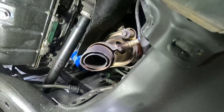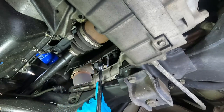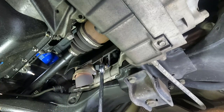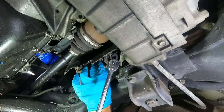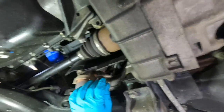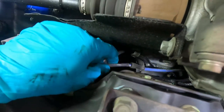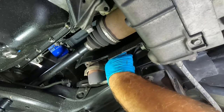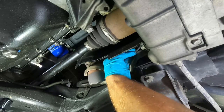We're taking off the rest of this pipe and putting on the replacement. I've got this oxygen sensor socket here — sometimes you can use a box-end wrench, but because of this flange here you really need this oxygen sensor socket tool. We're just going to loosen this, break that loose. It's also clipped in right up above. In order to not twist that wire up too much, I'm just going to take it out of that little clip and then unthread it. I think we can do this without disconnecting it.